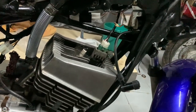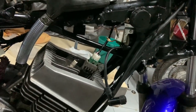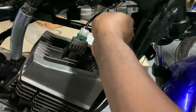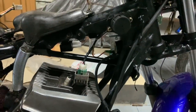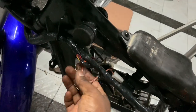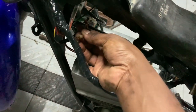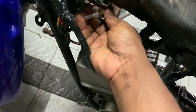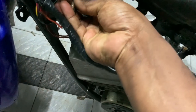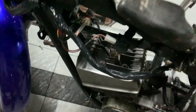I've connected the ground of the wiring loom to the ignition coil. The ignition coil is simple - just two screws, remove it and the whole thing slides out. This has an orange wire that connects to the orange female in the loom, and that orange female connects to the orange male from the ignition coil. I wish I had three hands - it is not easy to do with one hand.